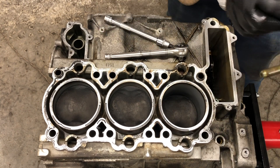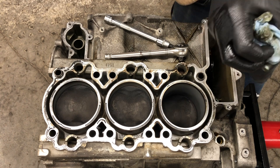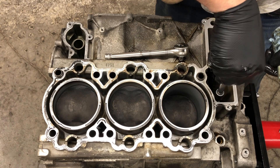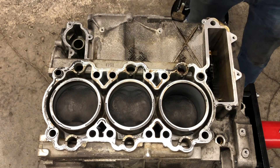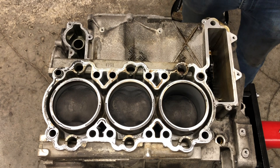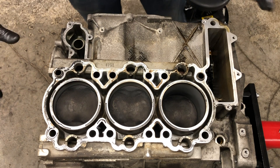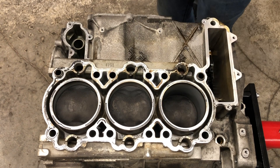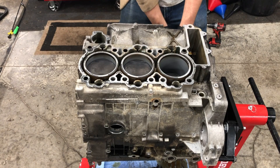Look at all that beautiful oil. Redline oil is the best oil on the market - not sponsored, I'm just saying it truly is the best. But the bad news is it becomes pretty difficult to do things when it gets on your hands, especially wearing rubber gloves that are nicely lubricated. When you're doing a thing like this, make sure that you're not prying too hard - there's always a chance you missed a bolt. You'll feel the difference between a bolt actually holding it down and just silicone that hasn't freed up yet. The only thing holding this in is the silicone and the ring tension on the walls. Just like that - I felt it separate.